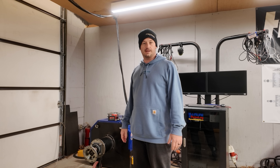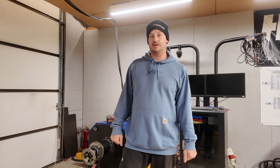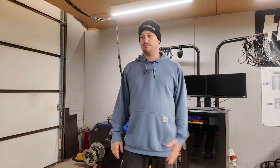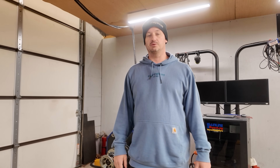Hopefully this is a once-in-a-lifetime thing. Hopefully all shop owners are doing what they need to make sure those yellow arms are installed before making runs. If you're considering putting your car on a mainline dyno, just be aware of these yellow arms and double check that they're in place before any run is made. When I purchased my dyno, I had the option of buying the bigger model or the one with removable arms. For most of the stuff I do, the portability, easy use, and space savings make the removable torque arm models significantly easier to work with.